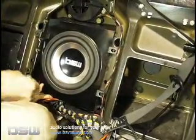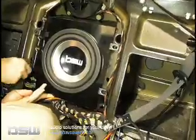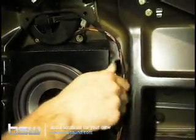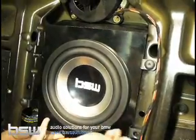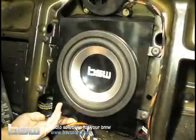With your left hand, keep it lifted up as high as you can. Then with your right hand, go ahead and start a couple of the bolts. I kind of start them catty-corner from one another. It looks like the brackets may be out a little ways, but that's actually the gasket on the back pushing it out. We're going to want to cinch it down.